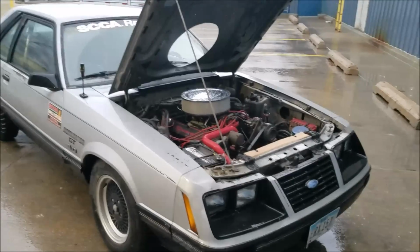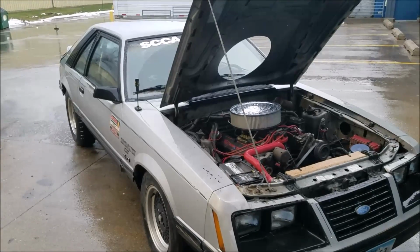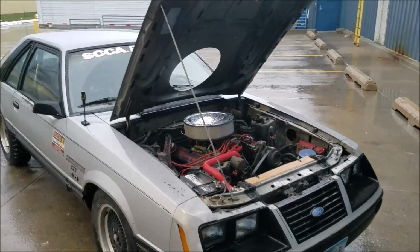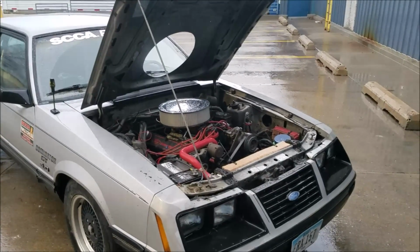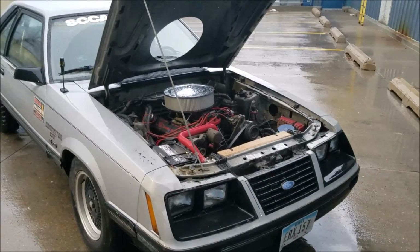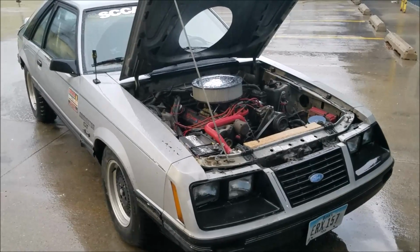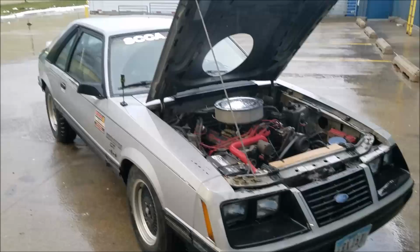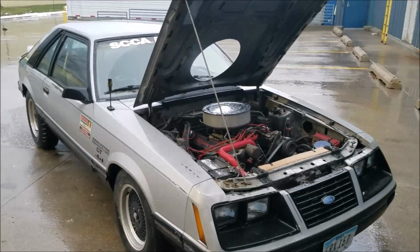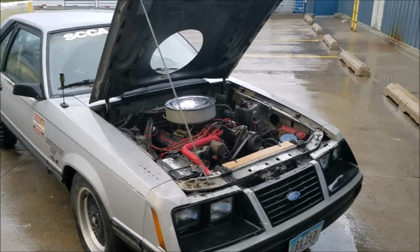So first of all, 20/50 oil is so thick. If you ever heard the phrase molasses in January, that is pretty much the only way you can describe this stuff when it's so cold. It's so thick that when you go to start your car, it takes a long time for that oil to get up through the system and all the way to the top of your engine. There's an old adage that most of your engine wear starts on your first initial fire up of a vehicle because it's running dry momentarily. Well, with that thicker oil, you extend that time.